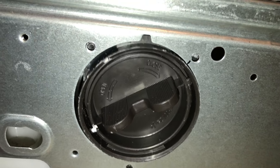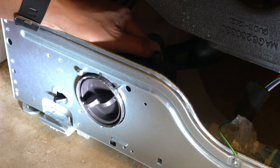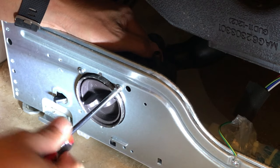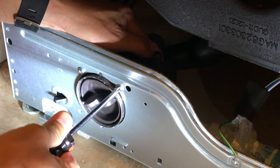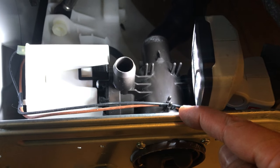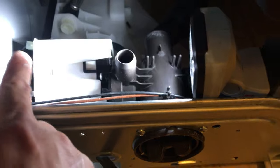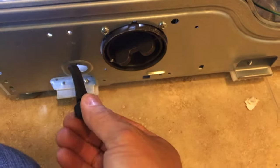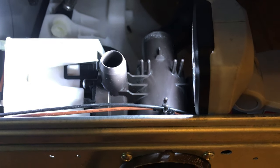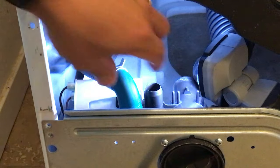That's in place. Put the two screws back on — don't forget it's plastic, do not over-tighten it. Quick review: cable is right there reattached, brown's at the bottom, black on top, drain hose connected underneath the pump housing and fed through the hole. It's time to reattach the hoses.